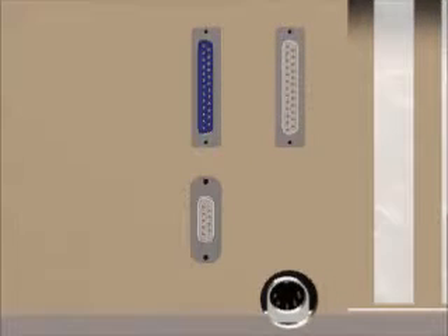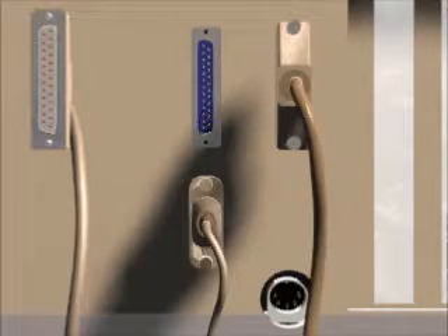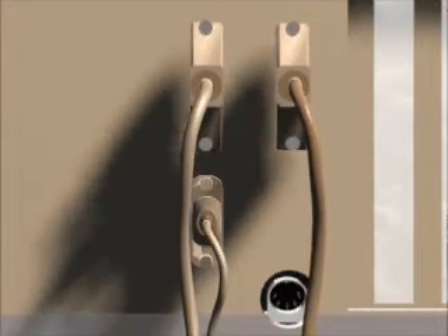The three ports you see here are vital to how a computer handles input and output. Most PCs come with two serial ports. There are two sizes of serial port connectors — one has nine pins and the other has 25 pins. Both do the same thing; it's just that on the 25-pin connector most of the pins are not used. It's called a serial port because bits of data are sent one after the other, like soldiers marching single file through a gate. That's why the serial port is usually connected to a mouse or to a modem, since current telephone lines can only handle one signal at a time.